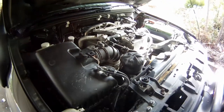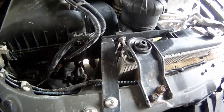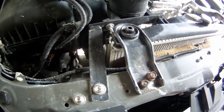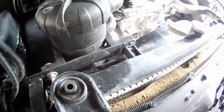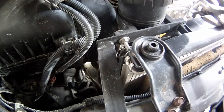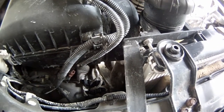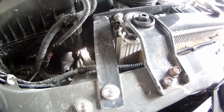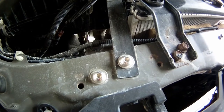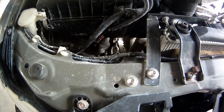What I did was I modded up one of my own little brackets — as you can see here, hopefully you can see what I've done. I just had some flat galvanized steel cut, a flat piece, so it can screw on. The first screw goes through into the radiator fan shroud mount. At the back of the piece of steel I simply cut with a grinder blade and welded in at cross angles a piece of steel at the right angle. You can see it screwed into one of the bonnet under-bonnet mounts — that was actually where the original bottle from the TJM snorkel replacement water fill bottle was, and it realistically had nowhere else to go.